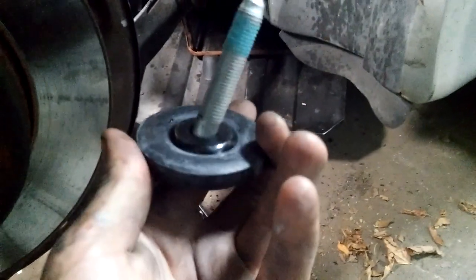Put the bolts in and you'll be done — you just have to put that cover back on. Lift this thing and put the bolts in. This bolt with the metal washer goes to the first bushing, and then the other one with the metal washer goes to the second, the back one. All the bolts are tight and now you're just left with the plastic cover right here — just reattach that. Everything is reattached as you can see, and we can just put the wheel back on now.